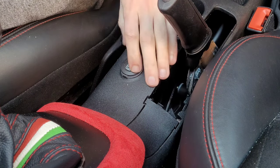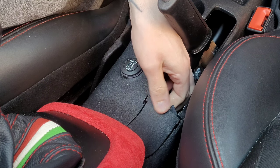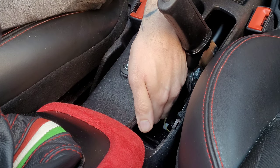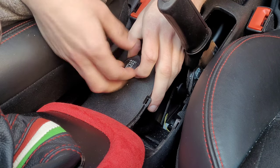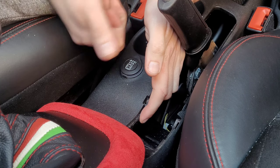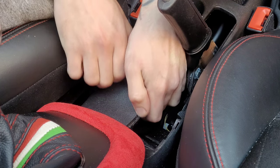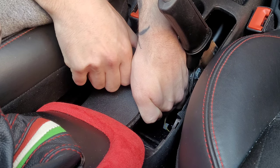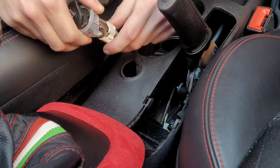Then give yourself a bit more room to get under here. Lift that up a little bit, slide towards yourself, pops out. Easy - takes a bit of force. There's like a big clip - you'll see when I get it out, it's easy to see. It wants to sort of, the top sort of leans back because of the big clip around the back here. Pops forward if you like, and then takes a bit of force, and then pull that out.